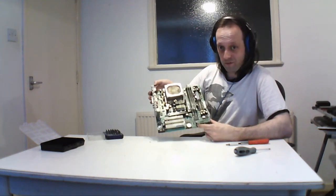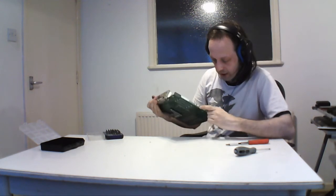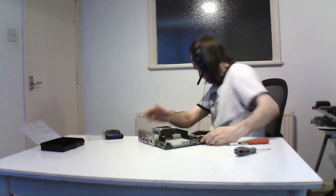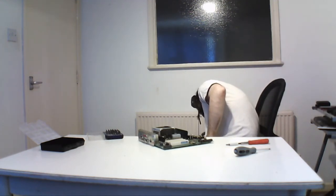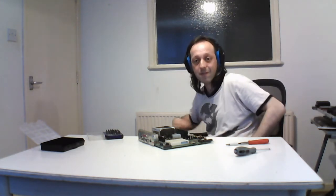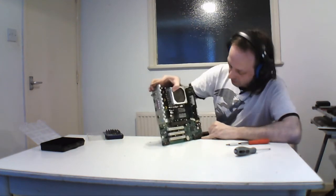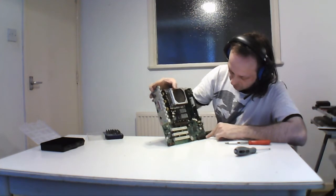Onboard system speaker, so that beeps when there's a problem. BIOS battery, 2 more jumper tags, which are for PCMCIA jumper, SCSI LED, front audio and CD. Oh, so it's basically written on all of it. Didn't realise that. They're upside down. But I tell you what, yeah. So that's where the USB is. That's the front port, USB port for the controller.